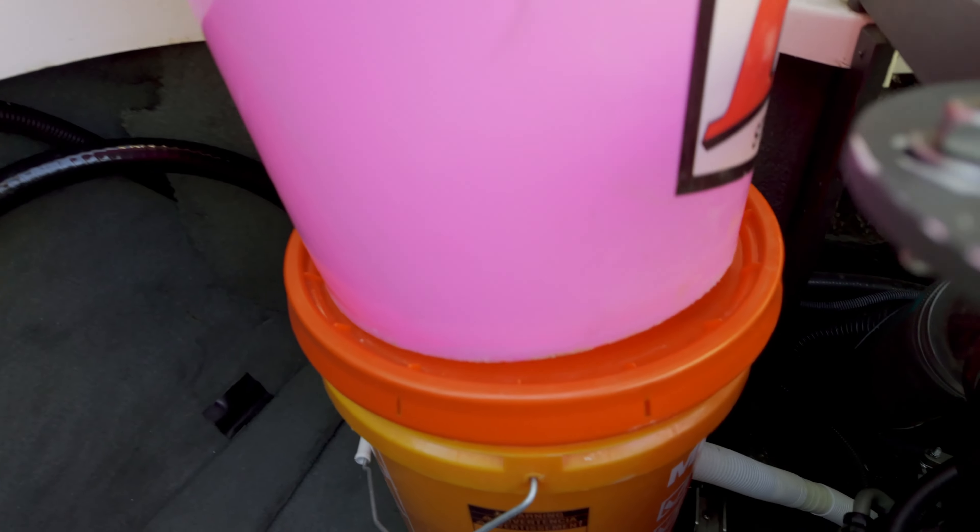We can fog it through the hose as well. We're now just past 160 degrees, so we're down to one hose in the bucket. We'll let the water run a little longer, then move the hose over the side of the boat and start pouring the antifreeze in. As the last bit of antifreeze is being sucked in, we'll spray a little fogging oil in and shut the key off. For pouring the antifreeze in, we let the water go all the way down first so it doesn't mix — that way you know you're pulling in just pure antifreeze.